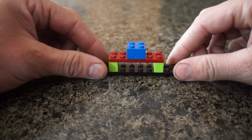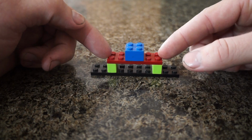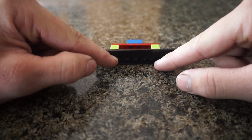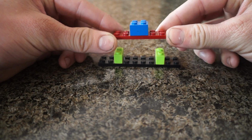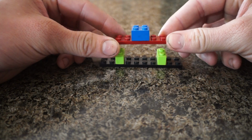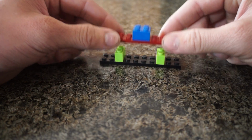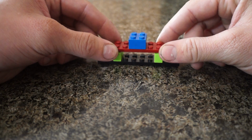So what you need to do is, for one, get the weight of the engine off the engine mount. So we're going to be using a jack today. Now we're going to unbolt the tops and the bottoms of the engine mount, and then we're going to jack the engine up. So get that guy off there. Now what I've found, the several times I've done it, the first time I did it, I unbolted both of them and lifted the whole thing up. But the issue with that is that it never comes up straight.